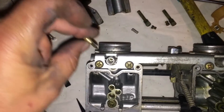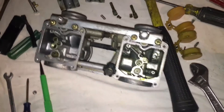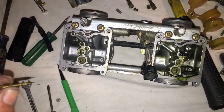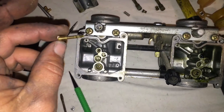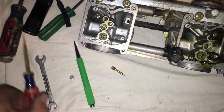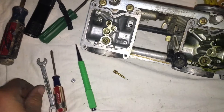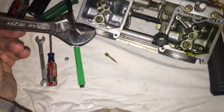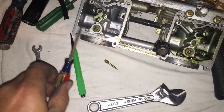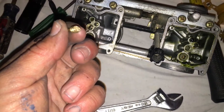When this comes out, everything on this carburetor is very frozen — throttle plates are frozen. I've had to be very careful taking all the jets out, and this would hardly move. You have to have a small screwdriver that you can reach down in there, and I put a wrench on my screwdriver to carefully turn it, because I don't want to slip off and screw it up so I can't get it out.